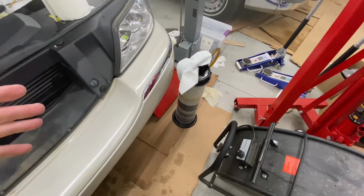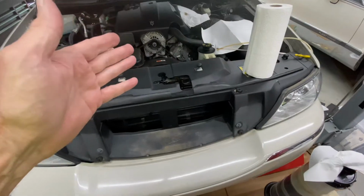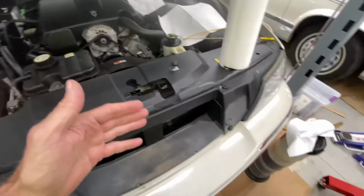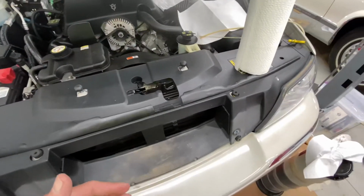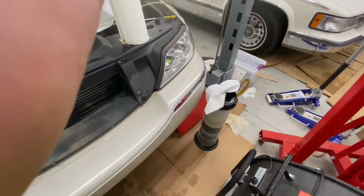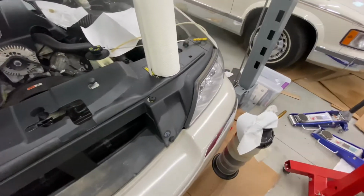It's a time waster. You've got to know the torque spec, which, by the way, on this car is 10 foot-pounds, which is pretty light. And it has a crush washer, which they then have to replace. And if you buy it at the dealer, it's like $4.50. And I'm not bemoaning what the dealer charges. I'm just saying that if you save $4, life goes on.